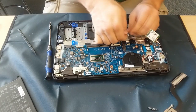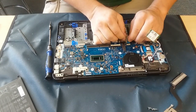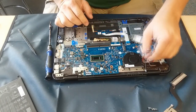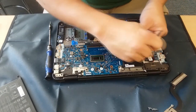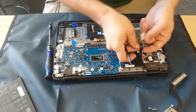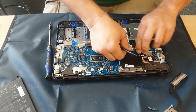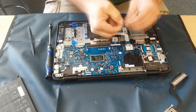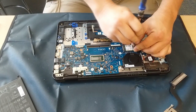One definite one there is for the keyboard — it happens to flip not down over the ribbon cable but from the opposite side of the connector. And then of course the one for the touchpad. You want to make sure you get these wires fed through and kind of underneath all the little hold-down mechanisms that are there around the fan and whatnot, as well as that little piece of tape that's holding those wires down for the antenna.